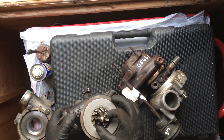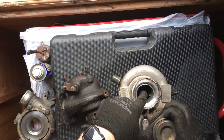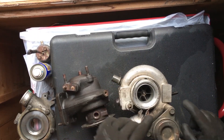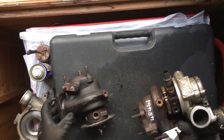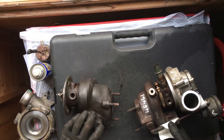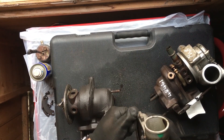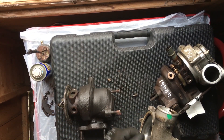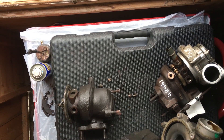You can see quite a lot of movement in the old one. I did get the new one from a scrap yard, but as you can see there's absolutely no movement in that whatsoever - it's a nice, perfect fitting. This is the TD04 HL-15T. This should give us a lot more power - it's a bigger turbo and it feels quite a lot heavier as well. I'm going to look at the lines to see if there's much difference. But first I'm going to quickly reassemble this one and put the housing back on. I did eventually get the bolts off the exhaust side but it's just not budging, so I've given that as a lost cause - no point messing around with it.